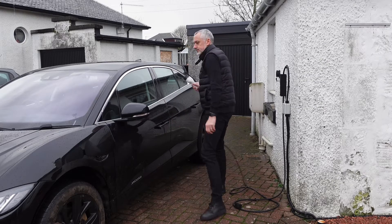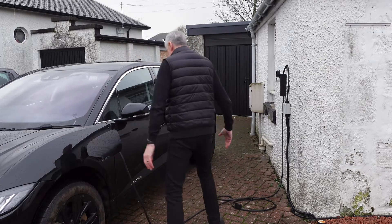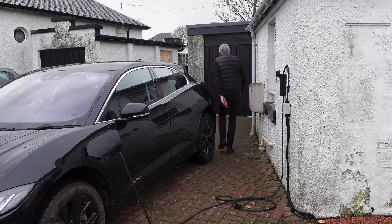When it comes to charging on a wall box at home on a 7.4 kilowatt wall box — remember most properties in the UK only have single phase electric — that will be the maximum speed you can get from your onboard charger at seven kilowatts. Even if you've got an 11 kilowatt onboard charger, you can still only get that seven kilowatts, as most UK properties lack three-phase electric. Most people will experience seven kilowatt charging and can expect speeds of around 17 to 20 miles an hour.